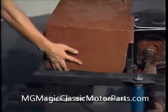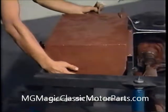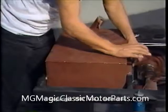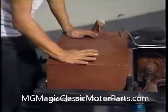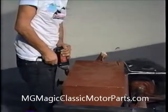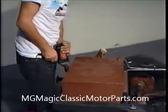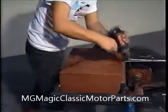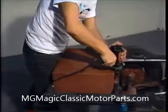Our gas tank is now placed into position with the fuel filler neck on the left or driver's side. We allow approximately 2.5 inches between the side of the tank and frame on the driver's side. Our electric drill, along with a 3/16-inch drill bit, is used to drill 3 holes through each mounting flange and top surface of the frame cross pieces.